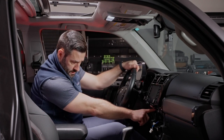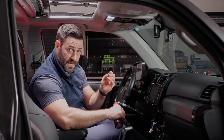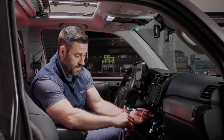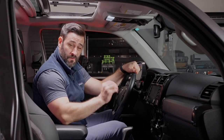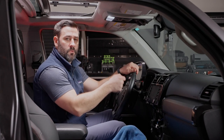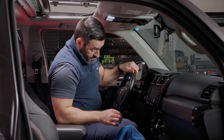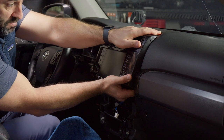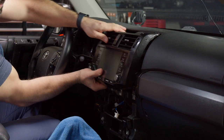Next we have four 10-millimeter bolts underneath the radio — there's two on each side. When you pull these bolts out, make sure to put them in your front cup holder because we're going to need those for the reassembly of the Sony 9500ES. Now we're ready to remove the head unit, but before you do that, go ahead and throw a microfiber on your shift knob because when we pull the head unit out while we're removing all the connectors, you can actually rest the head unit on your shift knob. The easiest way to remove this is to apply pressure top and bottom of the head unit pulling out towards you, one side at a time.